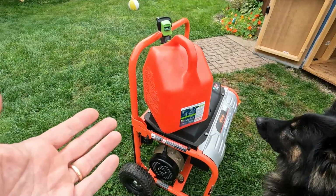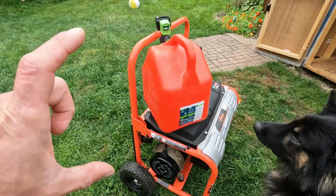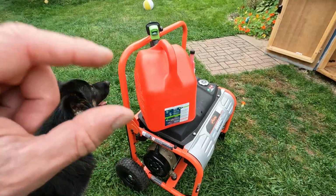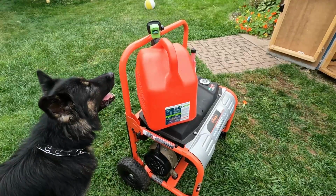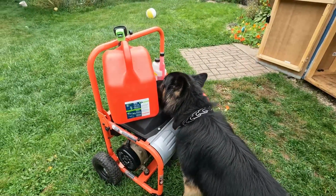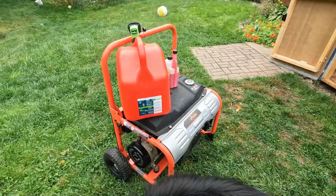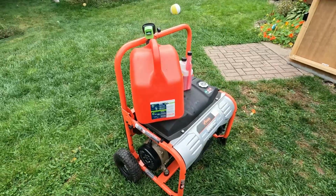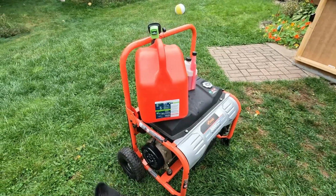It's just bad fuel. You know, take the fuel out and we have it sit in a container. You can see the separation of the fuel. You can see the ethanol and the main fuel separate, and you know that you have bad fuel. Pretty costly repair to have to drain the fuel tank and then have to refill it, maybe even replace the fuel pump because the fuel wasn't treated and the vehicle sat, or you used bad fuel.